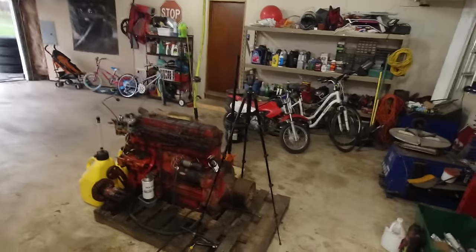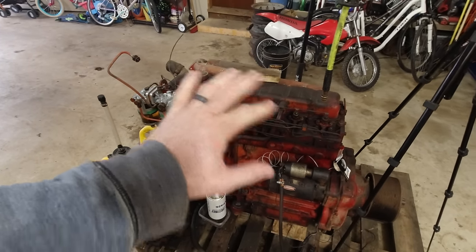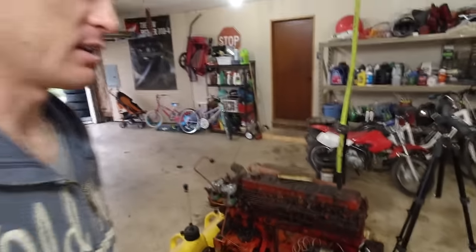Welcome back. It's been quite a while since the last clip. As you can see, I'm pretty sure the last clip was I was getting the injection pump back on and bleeding the system, and I just got frustrated because the system wouldn't bleed. It did the exact same thing as it did before. So I rewatched the video that I have linked in this video to rebuild the injection pump, and I realized the problem I'm having was most likely the high pressure pump in the injection pump.